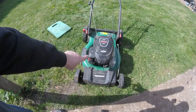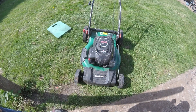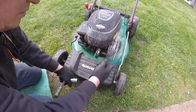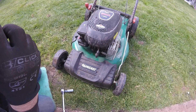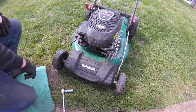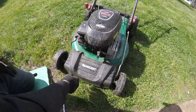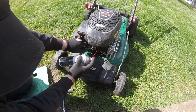I'm going to take the spark plug out, have a look at it, spray something in there and see if she fires. Because if it does fire, this could be a simple job of just cleaning that carb out and the tank — by the looks of it there could be loads of oil in it. This spark plug looks quite good from the outside. There's definitely fuel coming through there. I want to see if there's any oil that comes out — and there is a little bit, so we'll spray some gunk in there.